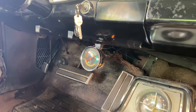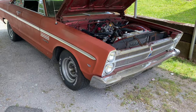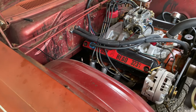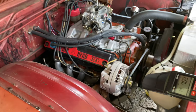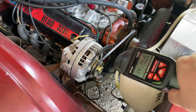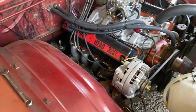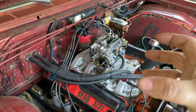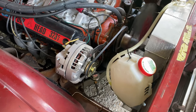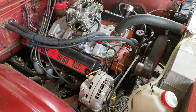That's perfect. So let her warm up, we'll come back and make sure the timing is on, and then set the dwell. She's pretty well warmed up now — we've got to set the ignition timing, and this is why you leave the distributor a little loose, because you may have to make adjustments. Take your timing light and aim it down at the balancer, whichever side your timing tab is on. There's a little tab with a white line on the balancer — you want to line it up with the zero mark. You may have to spin the distributor either direction to get it lined up properly, whether you need to advance it or retard the timing — that's going to be specific to your engine. This one's set dead on, so now we can just move on to setting the dwell.